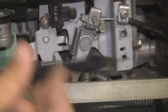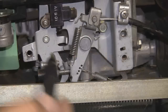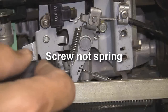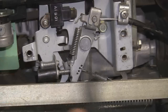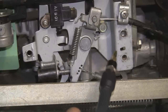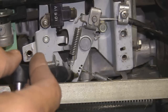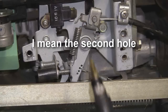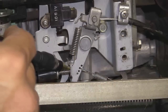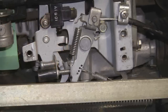If you look here, that spring was originally in the top hole. When I had the tacho hooked up and I unwound this spring — backed it off — the engine picked up a little bit of RPM, but it wouldn't pick up enough to get to 3,600. So I had to shut it back down and move the spring from the top hole to the front hole. The front hole is out of alignment by a couple of millimetres, and that allowed me to have enough adjustment on this screw here. That's all you've got to do to adjust the top end RPM speed.